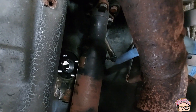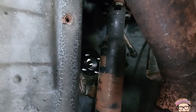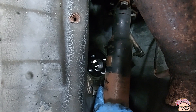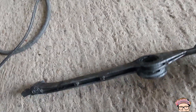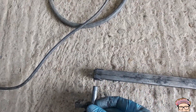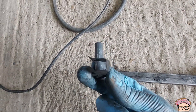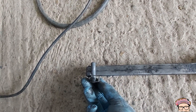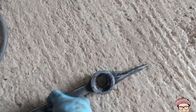Then we put the other shifter in and put the circlip in — and the bottom arm, and the top arm too, sorry, forgot that in the flow of things. It's been pushed in there so you need to push it forward to get it out. The shifter arm sits like this in the car and there's a pin through it. It's mounted on the edge of the gearbox — you fold it open with a little screwdriver, then you can remove it, and that one just slides out. Fairly easy and straightforward.